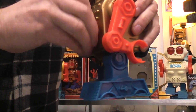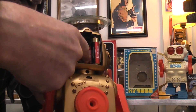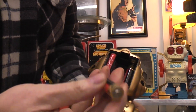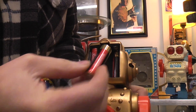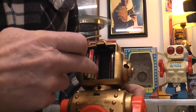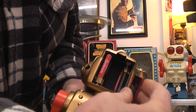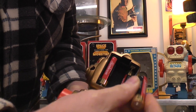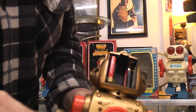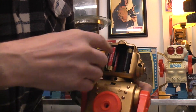Here's the knob for adjusting the leg height — quite a big adjustment. And here's that bizarre battery arrangement: it'll run on just two batteries since everything is in parallel, but there's nothing to keep the batteries from falling into the wrong position. If you flip one over, there's just solid metal across the contact — you've now shorted the batteries out and it's going to get real hot real quick. I'll leave the battery door off for now.